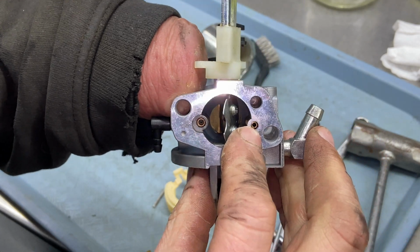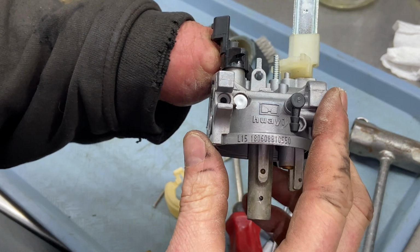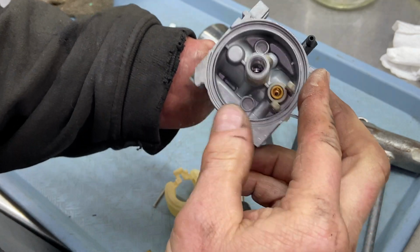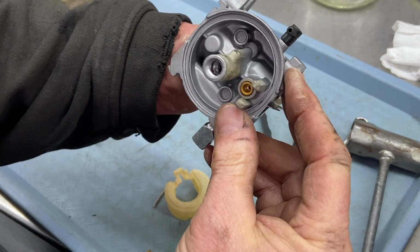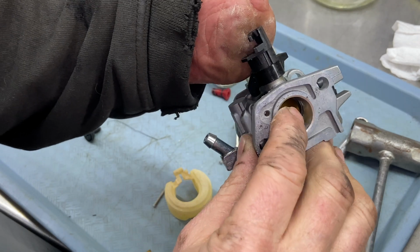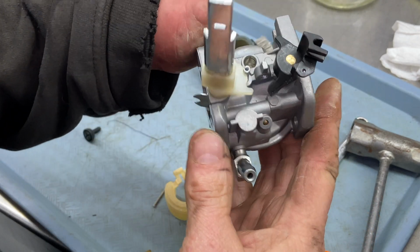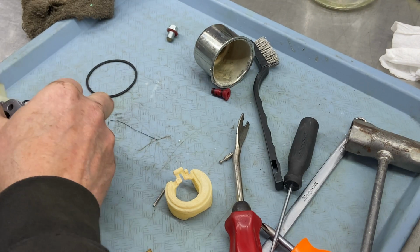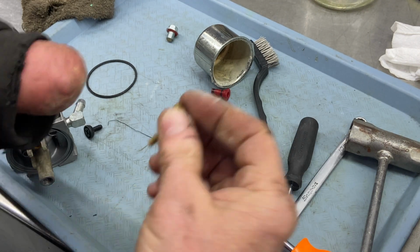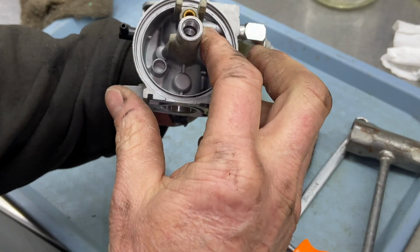If you have some kind of carburetor cleaner, gum cutter, you can go ahead and spray it in there. Be careful, that stuff is nasty, and you don't want to get it on your skin, and use safety glasses, obviously. I'll also spray inside those holes that we already cleaned out. I just poked them to make sure we can use them now. Some people ask me what we can put in the ultrasonic cleaner. Putting both jets.